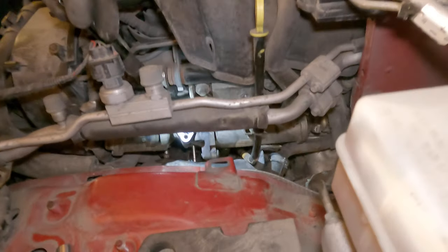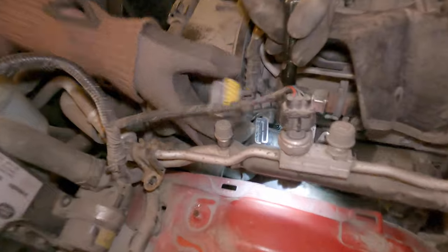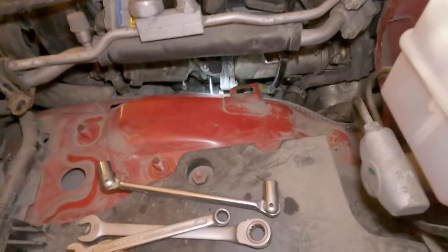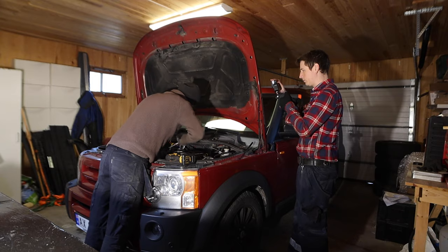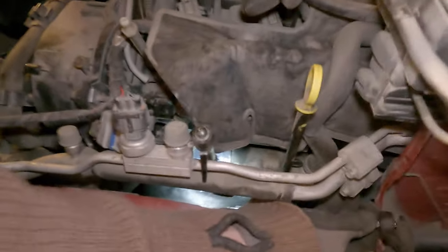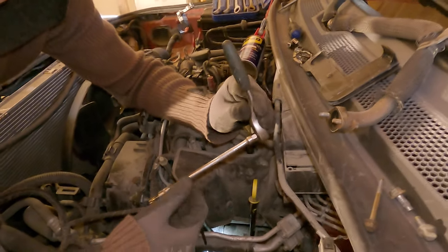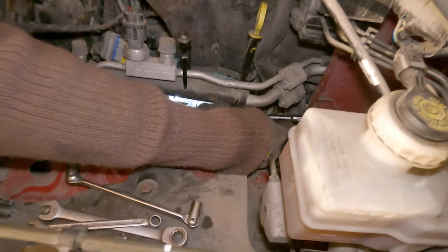So next step is the... we can do the connectors, but the cooler, this side. Next step is the cooler. We can do this bolt, I think it's Torx 30. The idea is to get an extension which is the perfect length. This is a bit too long, so we're hitting the firewall in here. So a bit shorter one. Yeah, I have one in my...